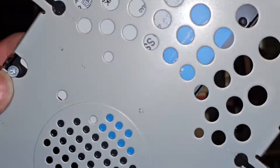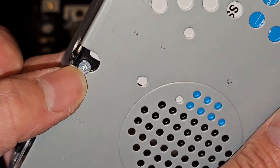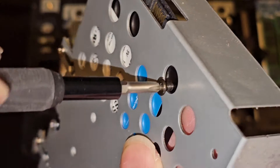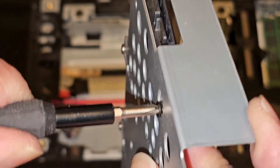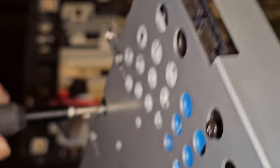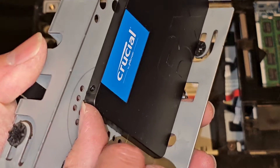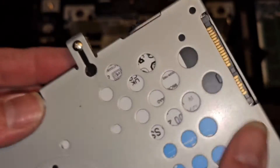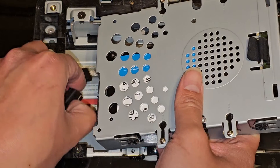Alright, I'll be back. So interestingly enough, some of the screw holes line up pretty nicely. The side one I put a screw here, and there was one on the other side, and there's actually one more here. So I'm just going to use these three screws — that will perfectly hold the SSD in place. You don't want the screws to be loose because you don't want them falling out and rolling around inside. I don't think that's going anywhere. We got the two corners basically secured in place, and now we can turn this around, get this all plugged back in, and we're going to install Windows to that.